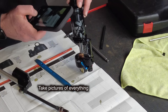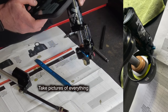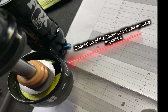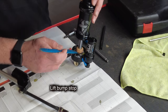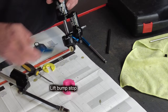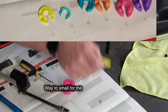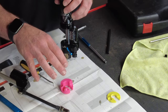We're going to take a picture of the orientation of the volume spacer installed — it looks like it's just off to the side. I like to use a plastic tool; you could use a screwdriver, you just have to be careful. The bike had a yellow one installed — not very much volume reduction.